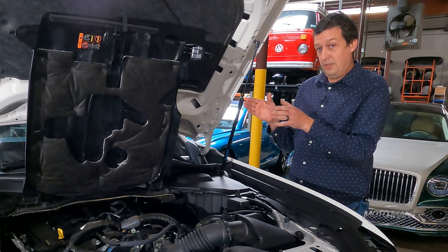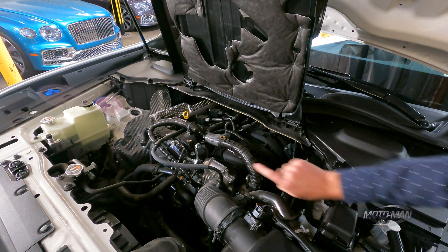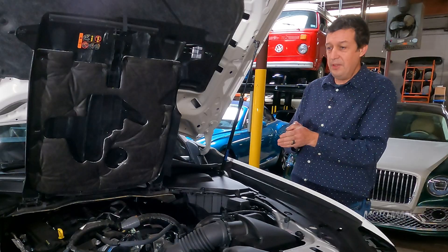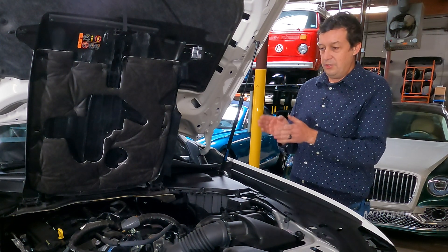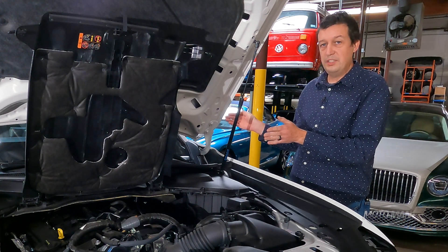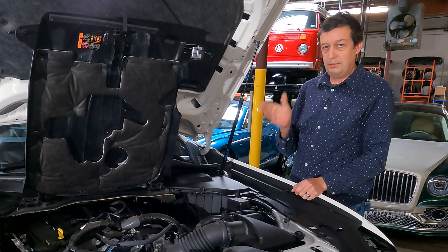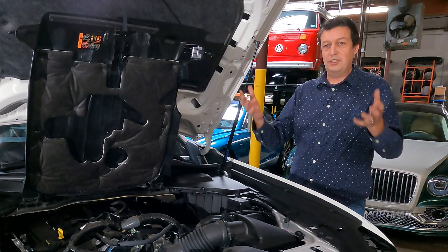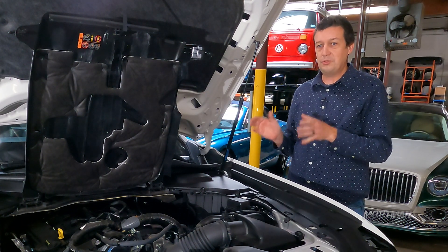The plug-in hybrid, very simply, we just make that motor a lot bigger and make the engine a lot smaller so that we can do more with the motor and less with the engine. Now this confuses people a little bit because it's pretty unusual for a hybrid system to run an electric motor driving through a conventional transmission. You're used to electric cars typically just having a direct drive electric motor with one gear, and people tend to think that electric motors have infinite torque and no power band at all — that they just make the same power everywhere. That's not quite true.